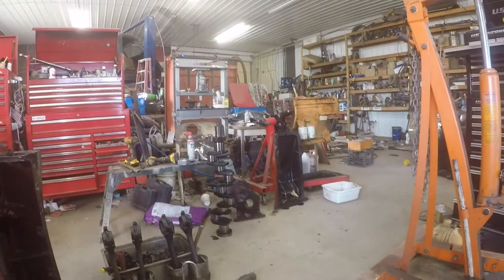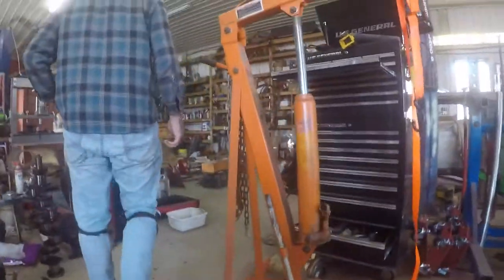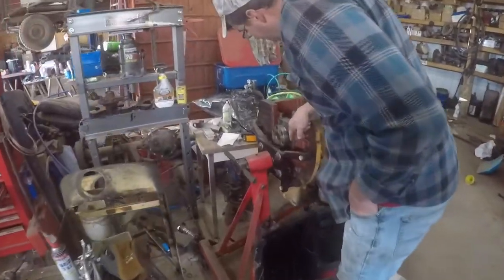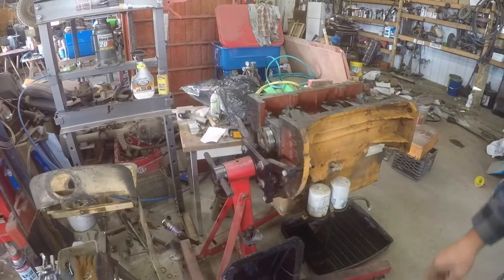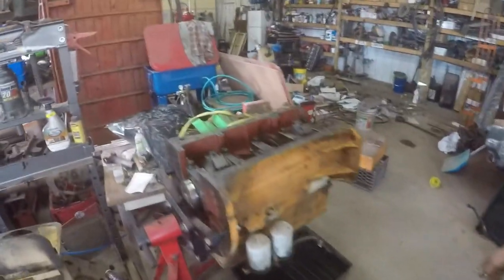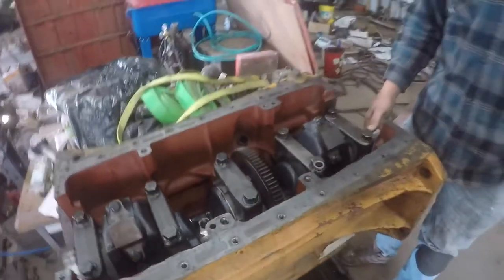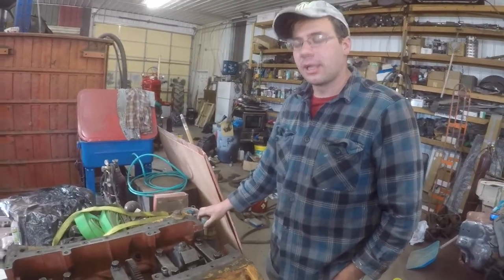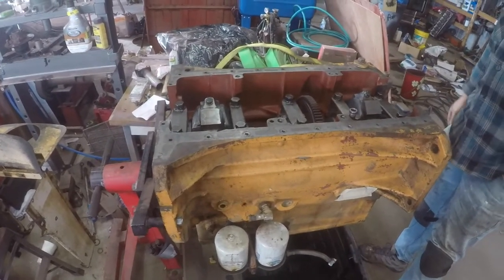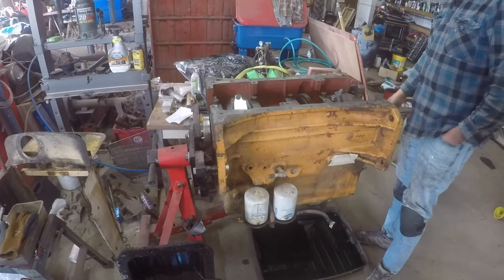There's nothing screwy on the back of that block that's going to cause us an issue with fluid. We've got the freeze plug, cam plug, and oil passage plug — all that stuff looks good and not leaky. Then we'll see if our poor man crank polisher, cheating the machinist, worked. The plastigauge is telling us it worked. This is like the one-in-a-thousand scenario where a spun bearing didn't actually kill us. It's a really great engine, especially getting it for the price we did because it was blown up.